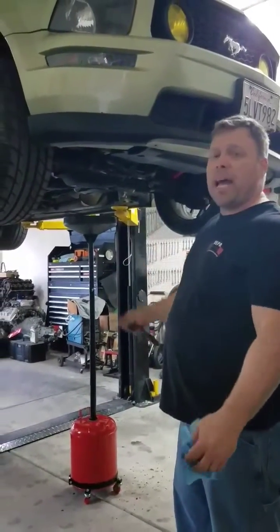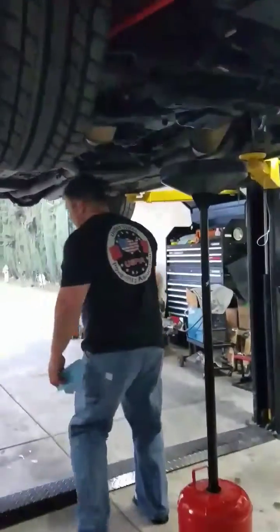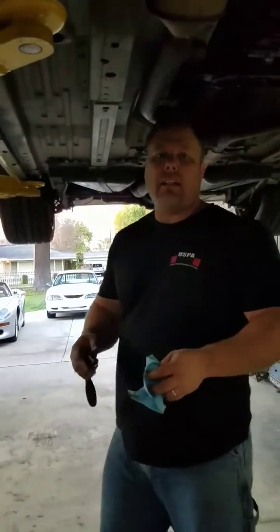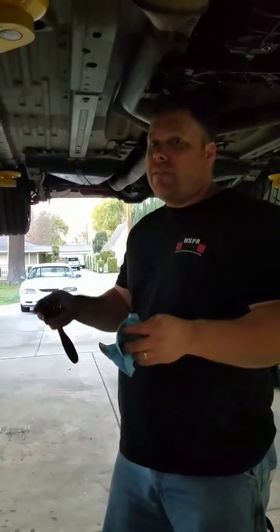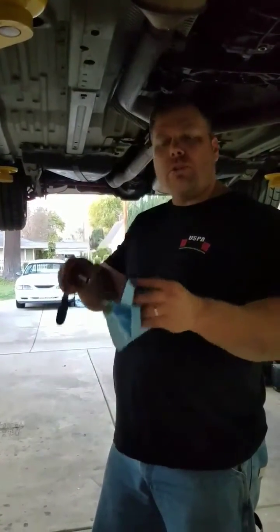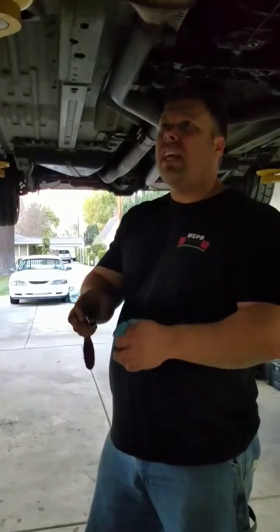The chassis aren't bad. If the cameraman will follow me under here, you can see compared to the Fox body, which is the white car out there, and I say Fox body because even though it's an SN95 chassis, it's still a Fox 4 chassis. It's pretty much the same chassis from 79 to 93. They've changed the outer skin, and they did some improvements to strengthen torsional rigidity through the car, but otherwise it's pretty much the same thing.